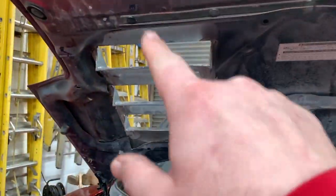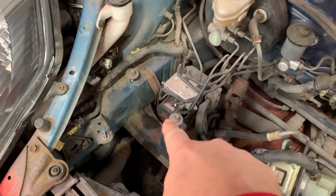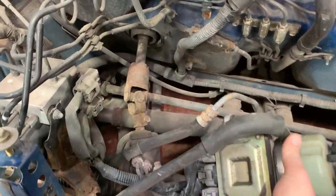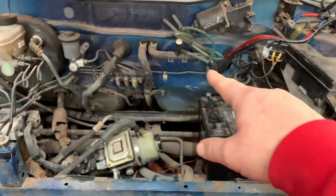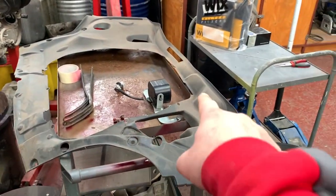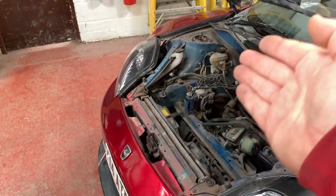Because of these vents, I want to duct from the back of these radiators up to the vents. A few things were in the way - the power steering pump was mounted there and was too high so it was hitting the vents. What I've done so far is disconnected the hoses, routed them under the cross beam, and we're making some brackets to mount it further back. The battery I'm going to mount up there too so everything will be towards the back. This space here will be open, and once that's all done we've got the plastics there - I'm going to cut that out, make it all fit around the ducting, put it back in so it covers everything up and make it look nice with ducting up to the vents so all the air goes through the radiator and out the top.